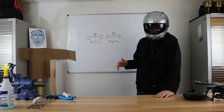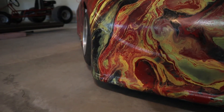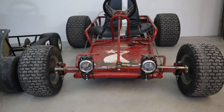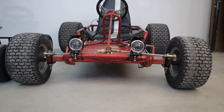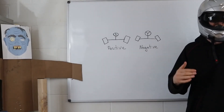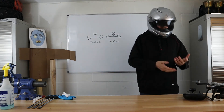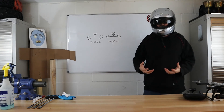Positive versus negative camber: on my oval track go-kart I'm running a negative camber, and on track you're going to see a lot of people using negative camber. On an off-road go-kart, I'm running a positive camber. To adjust positive camber on my off-road go-kart, I actually had to weld in the spindle holes and re-drill them for a different angle. On a lot of off-road go-karts you can adjust camber with the springs or the shocks. Things to consider: why would you run positive camber on a flat track? Maybe it's raining, maybe your tires are worn — just things to look into.